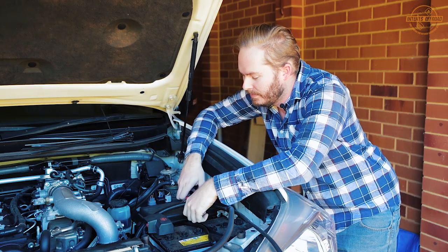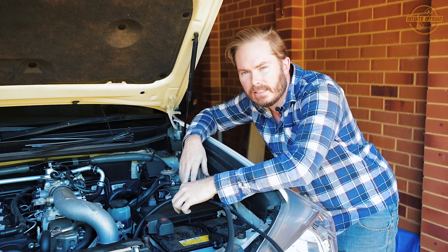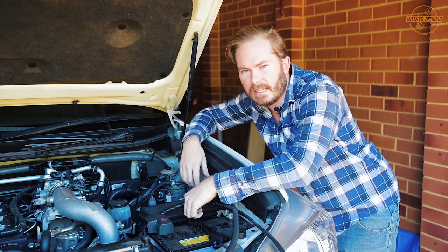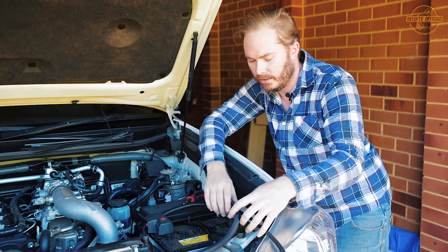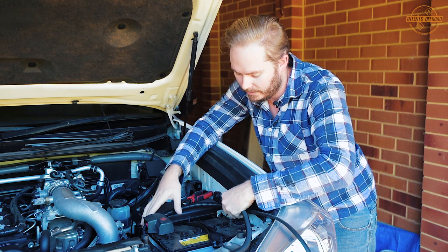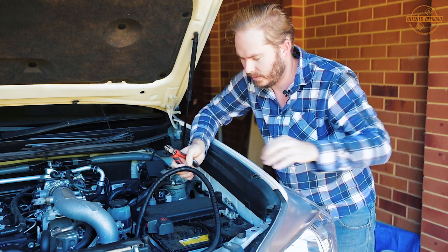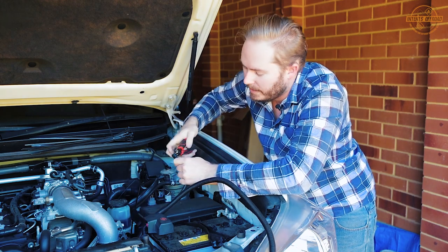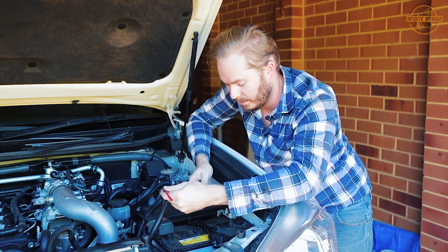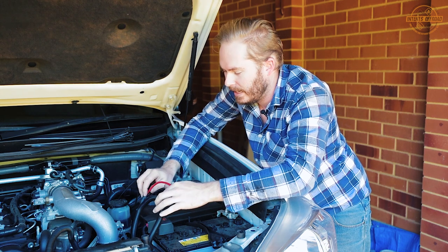There it is, run up to the front. When you're doing a cable run along the bottom of a vehicle, try and tie it along existing wiring looms, brake lines if you can find them, and failing all of that you can sometimes go through holes in the chassis. It's a bit tricky — it probably took me about half an hour — but you want to get it nice and tight so it's not going to wriggle around and cut through. Now I've got all this extra length. It's a twin core cable, so I want to come across to the negative terminal and cut it at a length where it'll still reach. Just pull that conduit back and pull away the outer sheathing — now you've got two bare wires. Cut this red one back to a length that suits the positive terminal, and this one here we can put a ring terminal on and go straight to the battery.